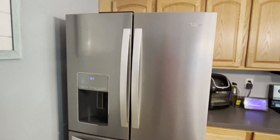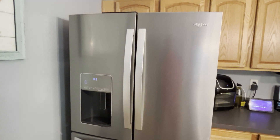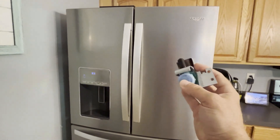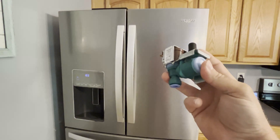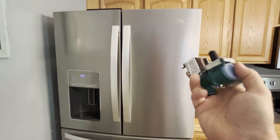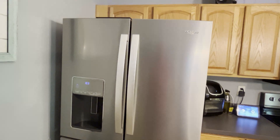Your fridge may have one or maybe two fill valves. I'm going to go ahead and replace the fill valve that's the easiest to get to — it's right on the backside of this fridge. Here's the replacement fill valve. It has a water line that comes into the top and then a water tube that connects at the bottom that goes to your filter, and it just bolts right to the fridge. It has a wire connector. It's really easy to change.